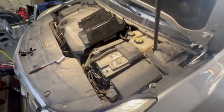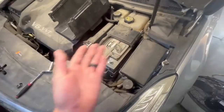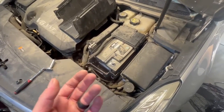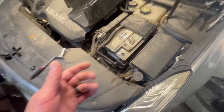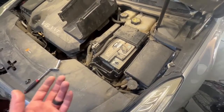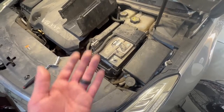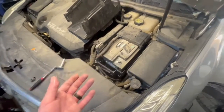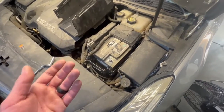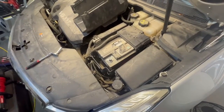Alright, first things first — whenever you work on your airbags or really generally any kind of electronics in the car, you always want to disconnect the battery. With the safety restraint system, there's a chance that you could deploy the airbags or seatbelts. So best practice: disconnect the battery for at least a few minutes. Generally a manufacturer, if you look through service data, will have the recommended time of battery disconnect. Going through service data on this Cadillac, I wasn't able to find any, but at least a few minutes should be fine.